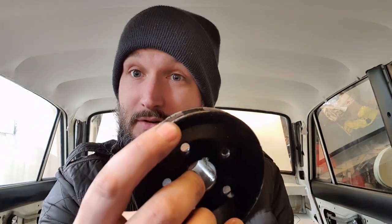One easy one was this pulley. This is the pulley that's been on the engine since it went back into the car. I didn't buy this one - it came with one of the engines. Someone has put two timing marks on it: one here, and then about 90 degrees in front of that, another one. I figured I'd take it off and replace it with a standard spare one - that's where the timing mark should be.